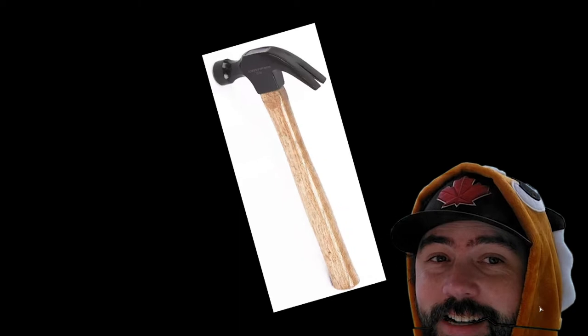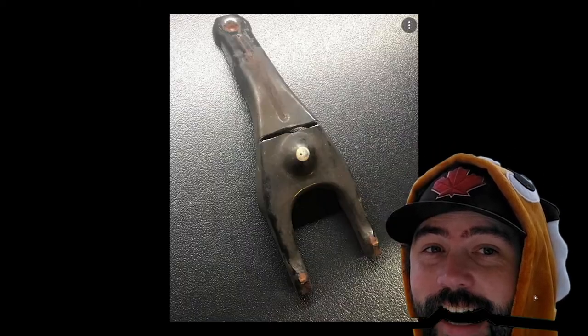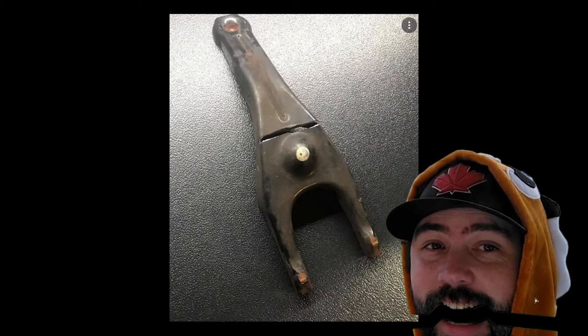So what's the problem here? Clutch kicking is kind of bad style. It doesn't look very good, but also it's really hard on the car. You're shocking the drivetrain over and over again, sending just big clumps of power on and off. It's hard on the clutch, the transmission, the drive shaft, the differential, and even the rear axles — but it ultimately just looks really bad.